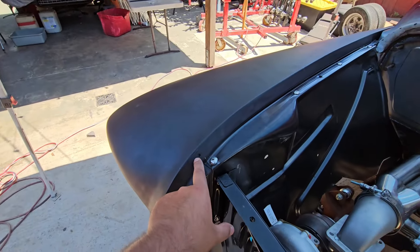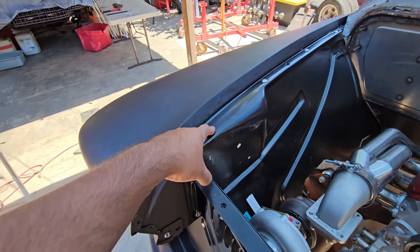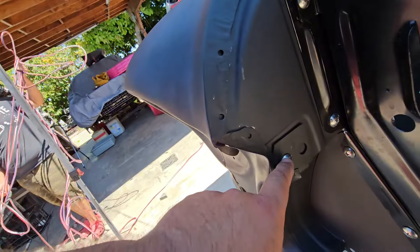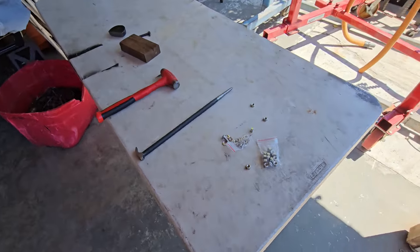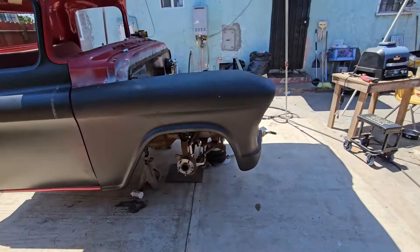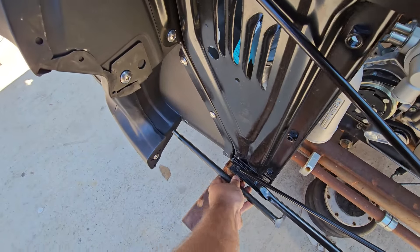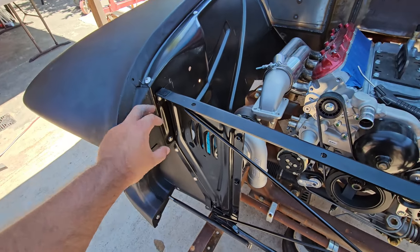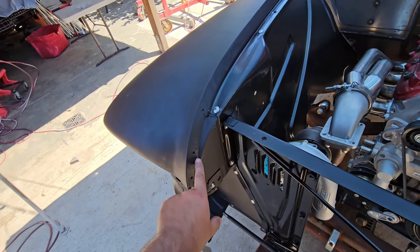You see these holes? There's another hole inside — these holes have to line up because there's a rivet that goes in there that holds these two pieces together. This is the inner skirt but none of the holes are lining up. What I did was line these big holes using one of those alignment tools — it's like a big alignment pin used for suspension. You slide it in, wiggle it until both pieces of body match, then use screws to tie the skins together. These are supposed to be riveted together but I'm just gonna put a little tack so they won't move.